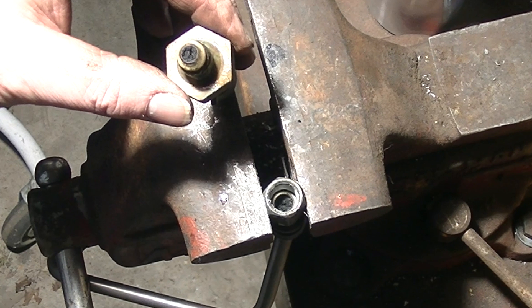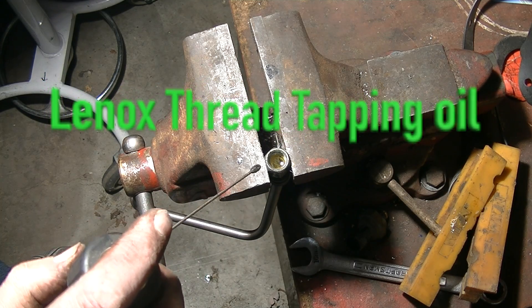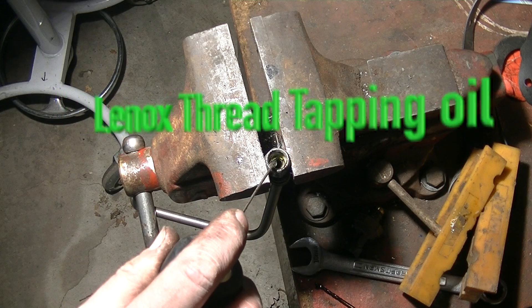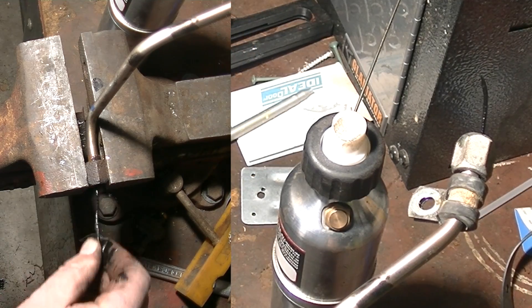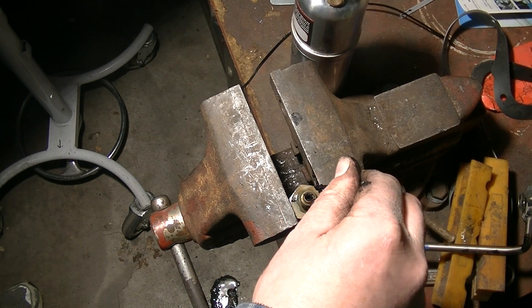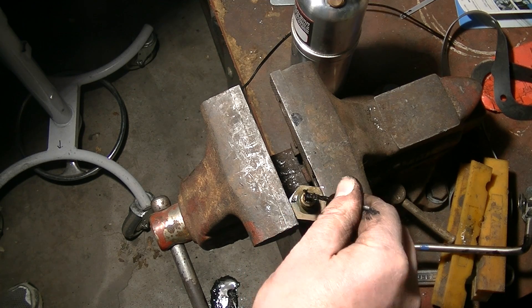The line is less expensive, so it was my guinea pig — I cleaned it first to test my method. I soaked the carbon with a Loctite tapping oil, and it dissolved the carbon quickly and easily, flowing out the end of the tube. I reamed the tube with a flexible multi-strand copper wire, then cleaned the sensor by hand with a drill bit, using the flutes to extract the softened gooey buildup.